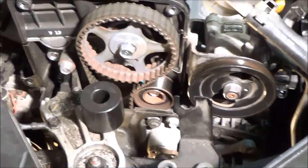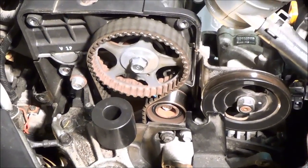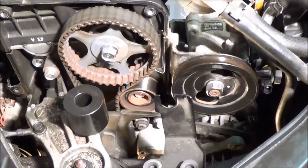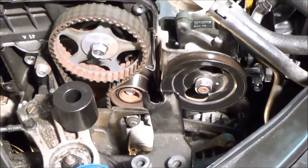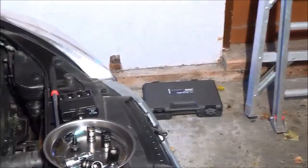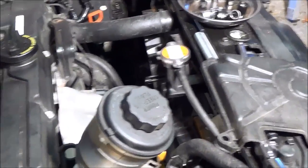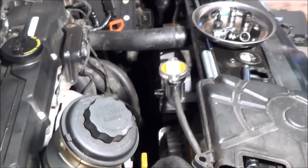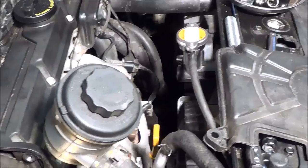We're going to get underneath and remove the bottom timing belt cover. But we can't do that until we remove the harmonic balancer and the harmonic balancer bolt. So I'm just going to put the cover aside against that wall. I put everything with its bolts laying up against the wall so I know exactly where everything goes when I put it back together. I suggest you do the same — keep track of what bolts come from which holes.